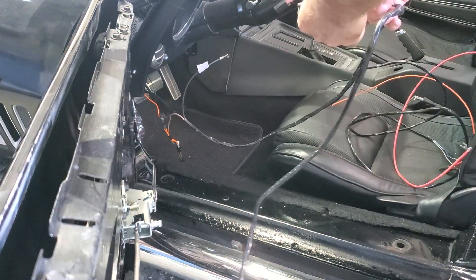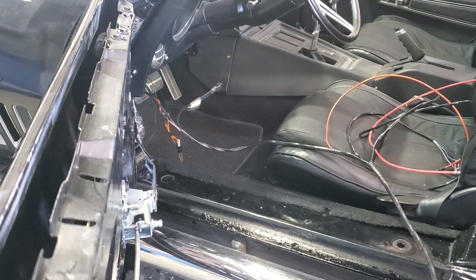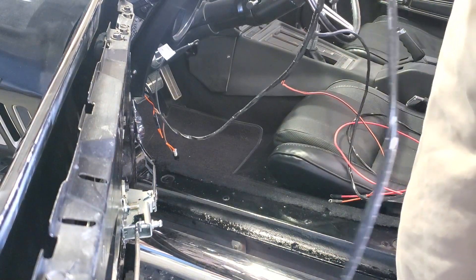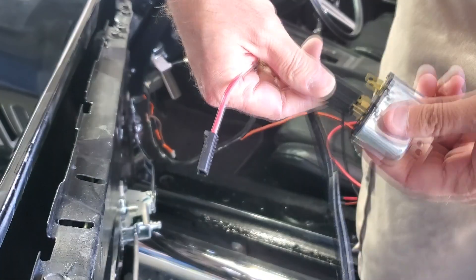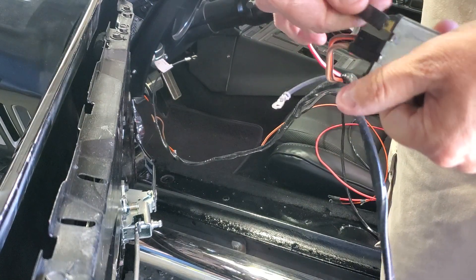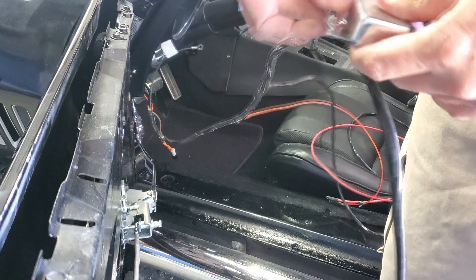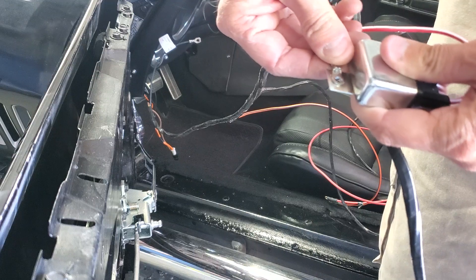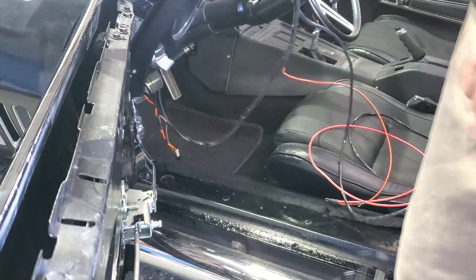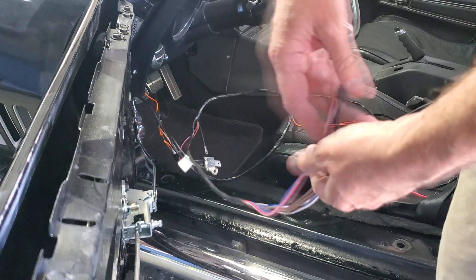Let me double check the wiring diagram. It comes with the relay — a power window relay. So that's what these connect to. You've got the one that goes there and that one goes there. And then the ground — they want you to bolt it to that hole there, so that grounds this out. That's going to be your ground. And then these pieces are going to go to your actual window switches.